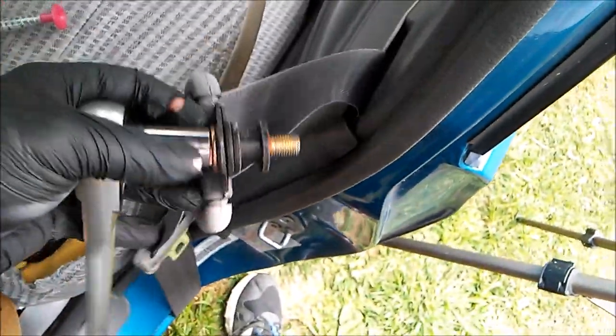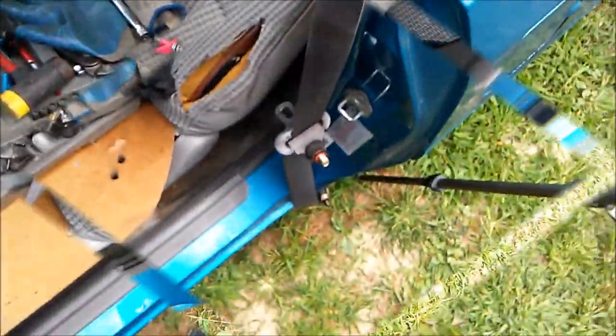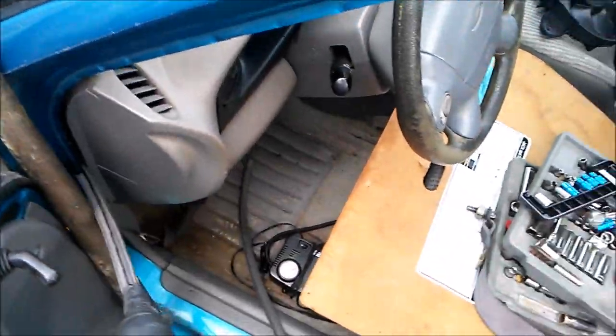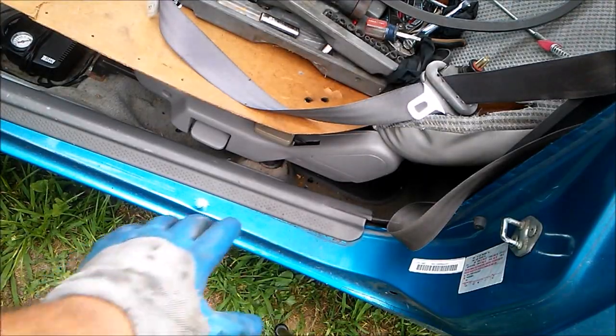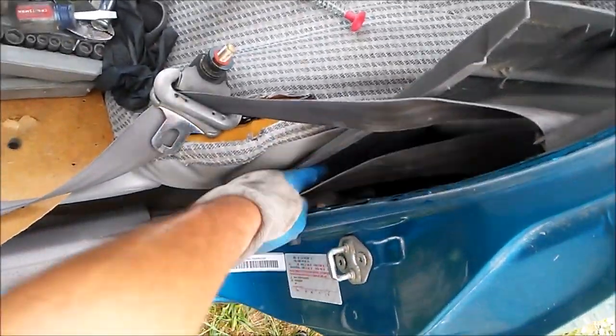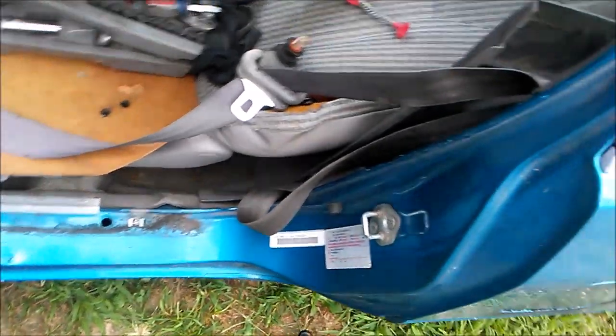So that's the top part. You've got to take a journey to the bottom of this. We're going to take out this little piece of weather stripping, and that will give us some access. You can take off the entire weather stripping. There's going to be a lot of paneling you've got to take off in order to get to this bottom device inside here. It just pops right off — it goes right into the little clips. Let me give you a closer look.